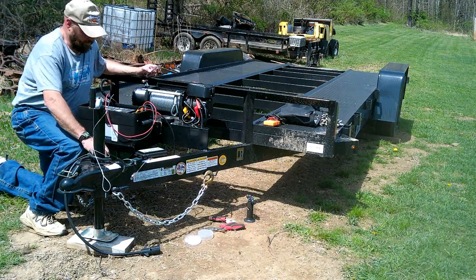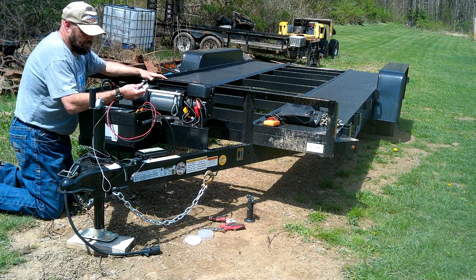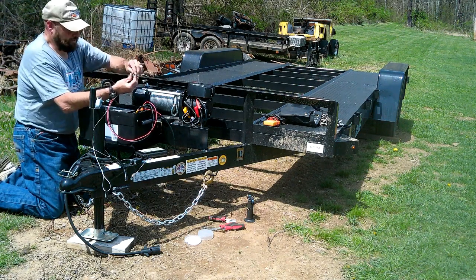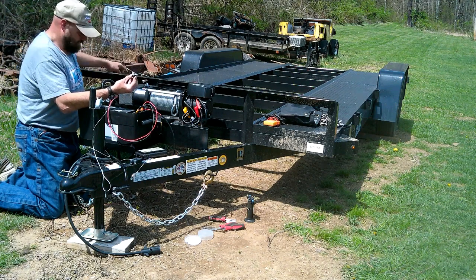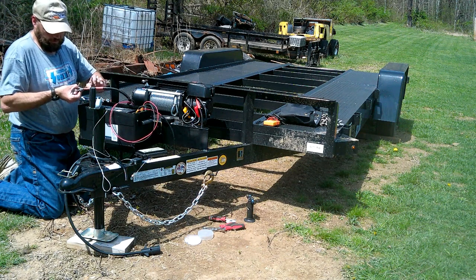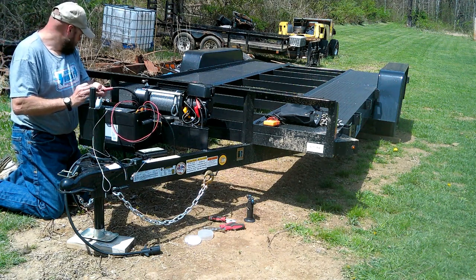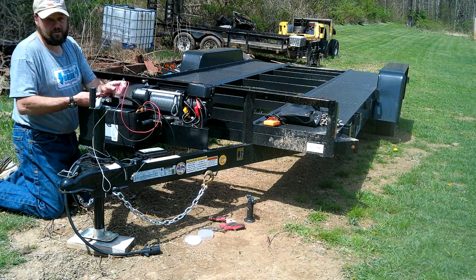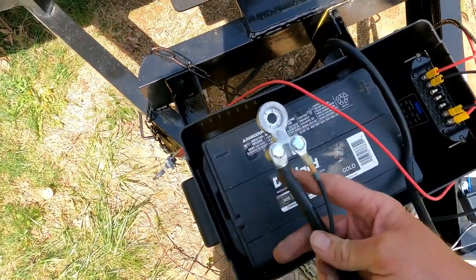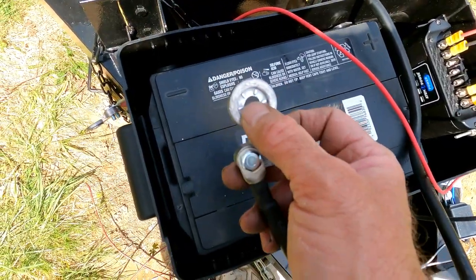So I got the right size wire loom — I'll get that tucked on. Now to hook this to the battery, I'm just using GM style battery clamps that I got from Advanced Auto. But how I'm going to use them is I'm going to remove the band. The winch is going to go to one side, and then I'm going to put a ring terminator on the battery charger side — that's going to go to the other one. Here you have it — you have the winch and then you have the charger, both under their own lug going to the main lug to the battery.